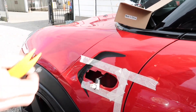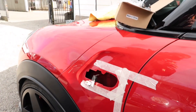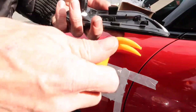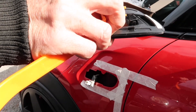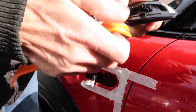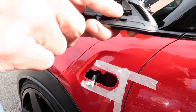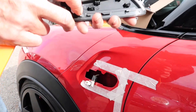Obviously it's advisable to clean behind there, and then we'll go on and show you how to install the new one. So we've got the old one off. Obviously if you're just replacing this bit and not the indicator — I'm going to put a new set of indicators in as well. You can see there these four little tabs. What you're going to do is pull those back starting at the top — it is fiddly because you've got to pull that back and pry that away, pushing the tab in there, and work your way along to all four. There's a possibility you might snap one, but it won't make any difference when putting them back in.